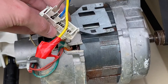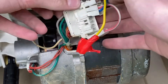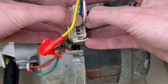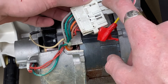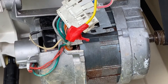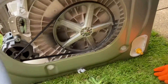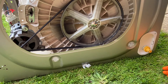So let's put the neutral here — live or neutral can go in either of these ones. Then a jumper cable goes from a brush into a winding. It's a bit tightly packed but that's how it is. So that's going into the orange one, this is going into the green wire next to the orange one, and this is going into the other green wire next to the gray. Then the brown's going into the gray one at the top. Without further ado, let's test this and see if it spins — let's zoom out so you can see the pulley turning and see how fast it can go.